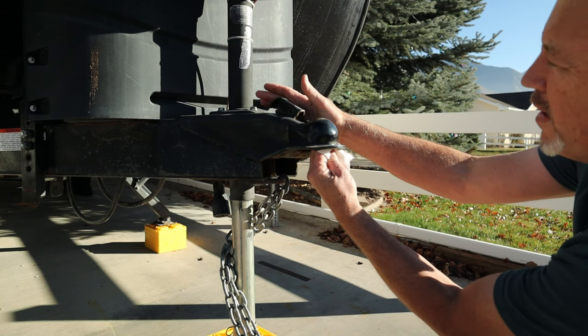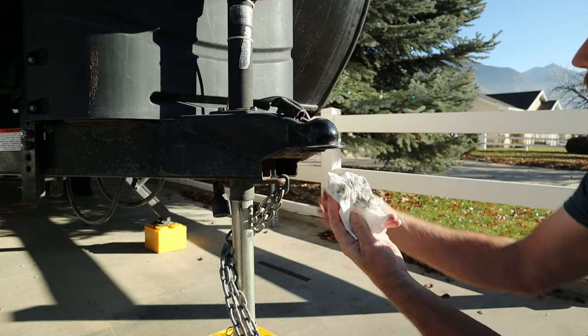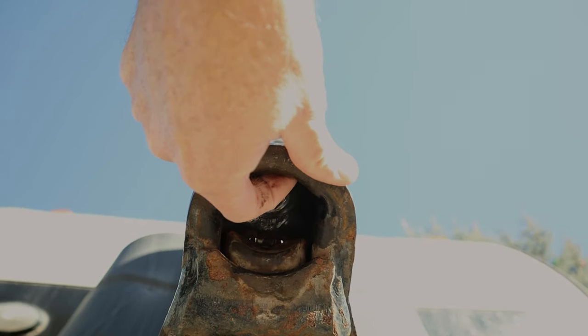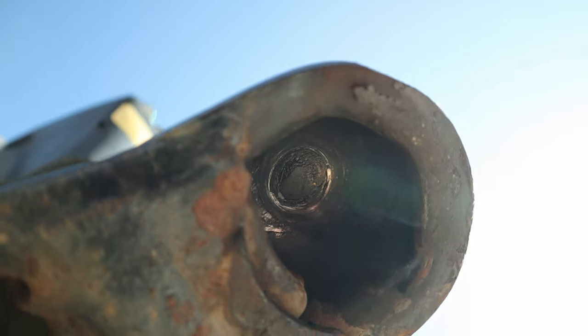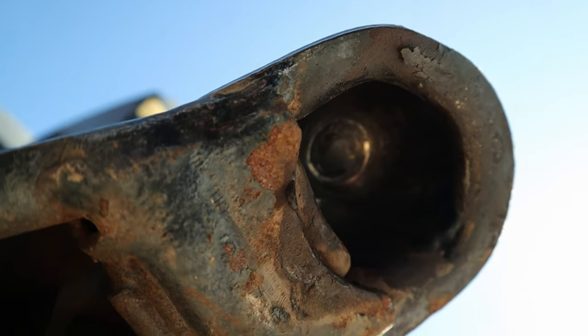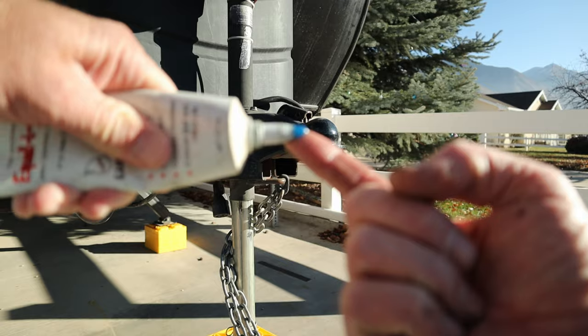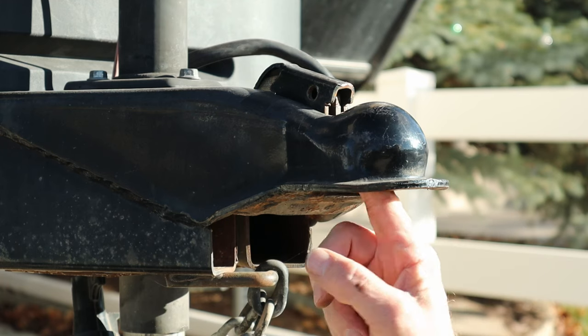Some people like a dry lubricant, some people don't like to lubricate at all, and then there's grease. Let me know in the comments down below what kind of trailer puller you are. Cleaning the coupler is no big deal — a simple paper towel and wiping around the surface of the coupler inside here is going to clean that thing off sufficiently to add new grease. You don't have to overdo it, but you just need to put enough in there so that you create a barrier between the surfaces.